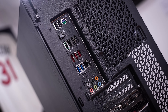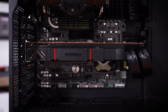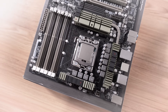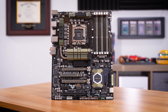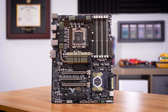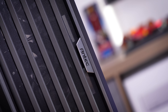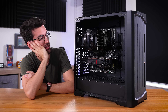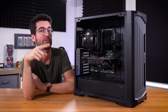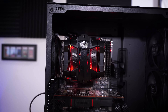Now on to this thing. This build was assembled with fairly old hardware. The platform is extremely old — about a decade or so, actually a little older if you consider the age of the CPU. It's a Core i7-980X, which debuted back in Q1 of 2010. An X58 motherboard is paired with it, along with 24 gigs of DDR3. I threw in a somewhat time-relevant graphics card, an R9 290 — purchased used on eBay, although it appeared in fairly decent physical shape. The case is a much newer Antec Performance One Silent, part of a brand deal we did with Antec.